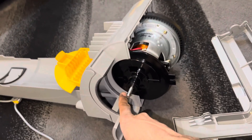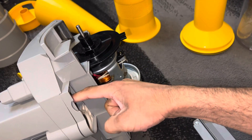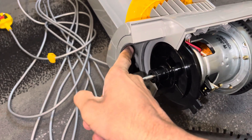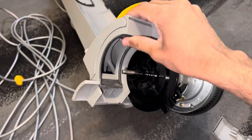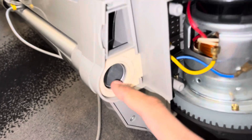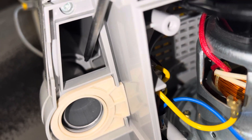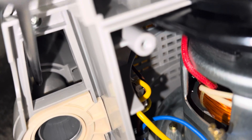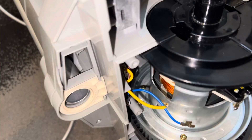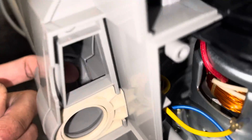This is a really clever design as part of the changeover valve. When the vacuum is in the upright position, this huge opening gets blocked off by the curved section of the cleaner head, and then the suction has no choice but to go out of the hose. When this huge opening gets blocked off, the vacuum can't breathe anymore and suction does not go to the hose unless you pull the wand out — because the bottom of the wand is blocking the air path. When the wand is in the vacuum there's no suction at the hose until you pull the wand out.